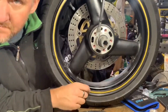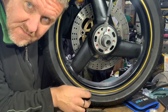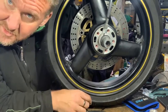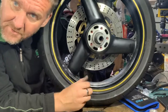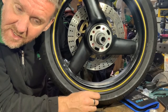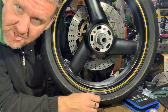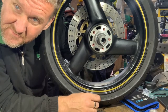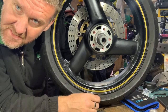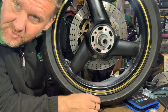I've got a tank, whether I'll video it, but it's had a little bit of surface rust in the tank, which ended up going around through all the carburetors. That's why I stripped the carburetors initially, and I'm going to flush the carburetors and the tank. I've been advised by a couple of people, first of all, fill it up with fuel, slush it all around, give it a good swill, right to the brim if you can afford it, and then leave that overnight, drain it out, dispose of it correctly, and then white spirits. I have mentioned this before, got to do that at some point.